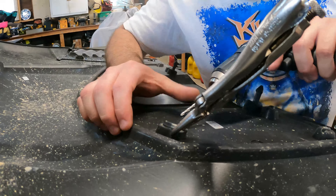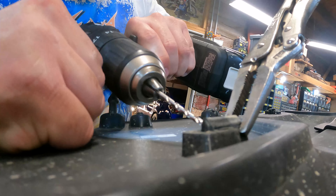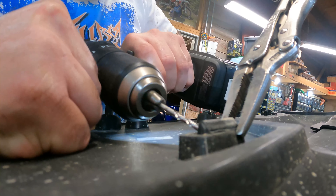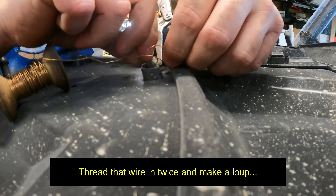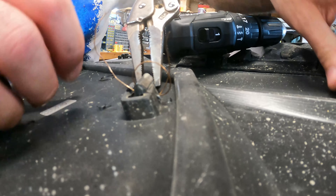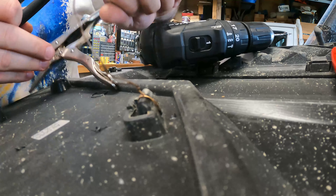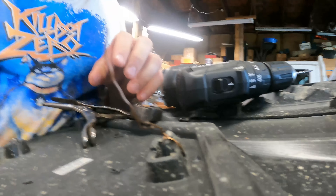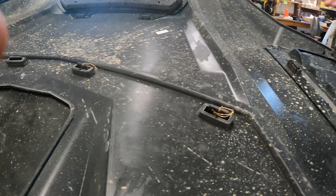I'm going to grab it and come down at the bottom right here and drill a hole through the tab, right to the underside of this. It's kind of like sewing. Now I'm going to cut this, tighten this up, let go of the vice grips, and that is not going anywhere. Then we'll just trim the little excess off here when we flip the hood over.